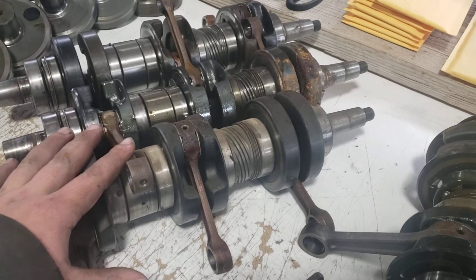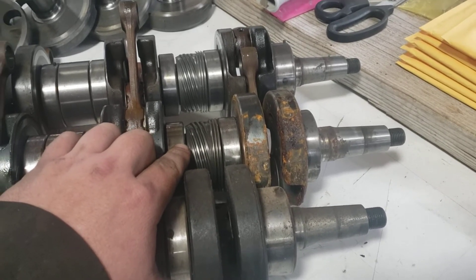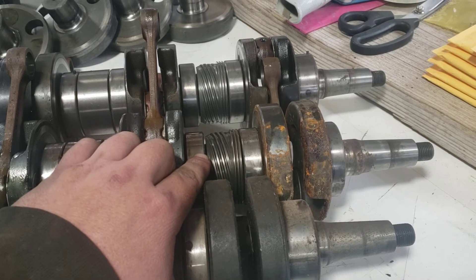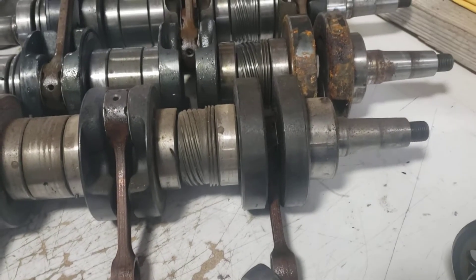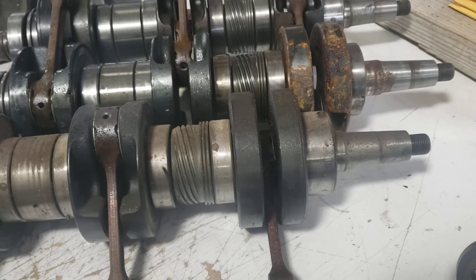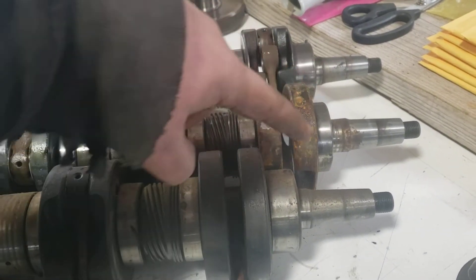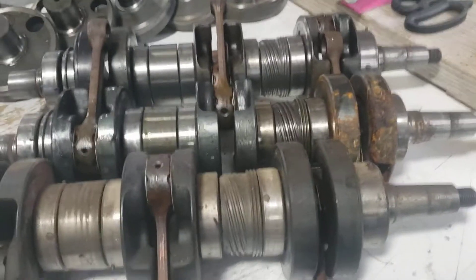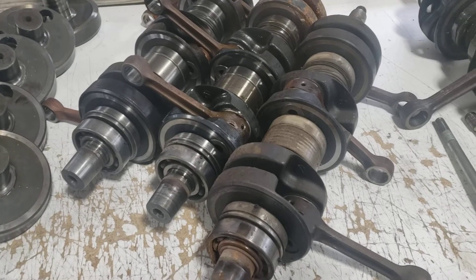The 580 and 600 connecting rods are all the same. In the first couple years they had a 64 millimeter bore and 60 millimeter stroke, then around 1994-1995 they went to a 65 millimeter bore — one millimeter bigger piston for the 600. As far as the crankshafts go they're the same other than those bearings. You can put a wide bearing on the 580 crankshaft or a narrow one on the 600 — they're interchangeable. These are built by Fuji Heavy/Fuji Motors: the 580, 600, XLT, and XCR.